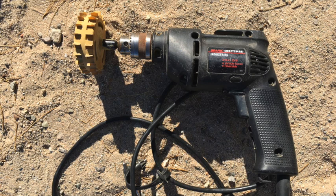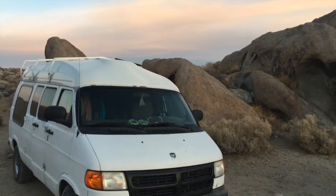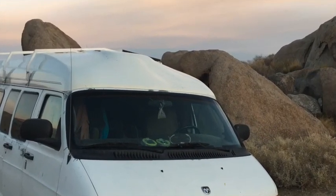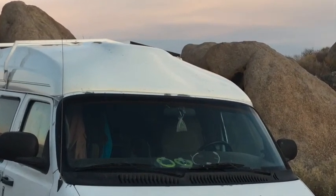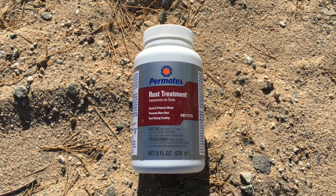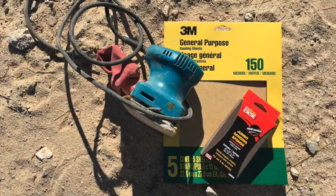There's a close-up of the wheel when it was new, and that is what it looked like when I had done the entire van — almost spent. Then it was on to fixing the problem of some rusty spots I had above the front windshield. I sanded the rusty spots with both a heavy and fine grit sandpaper, removing the rust, and then applied the rust treatment. I think I bought the rust treatment at a Napa or O'Reilly store. Hopefully this means that my paint job will last longer.